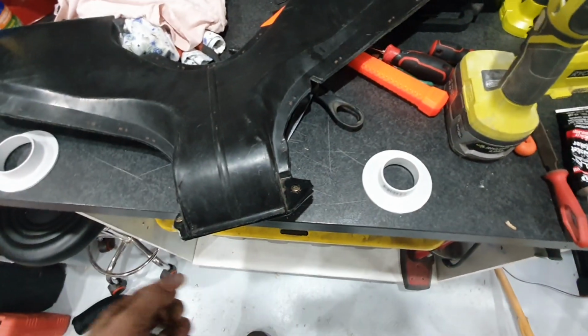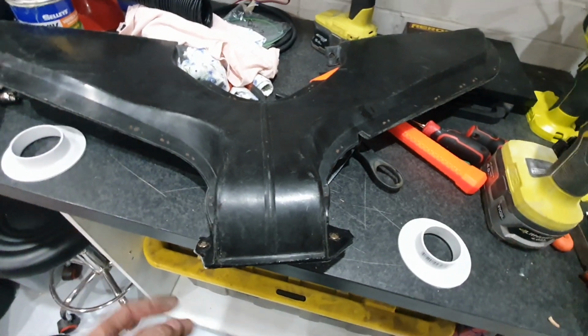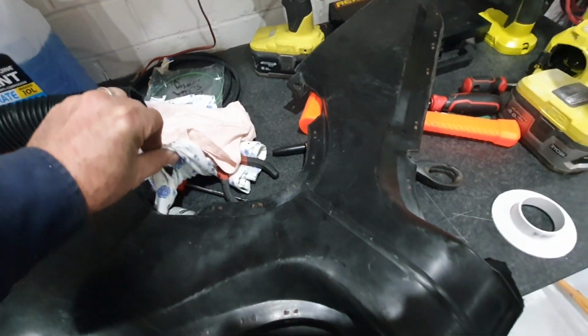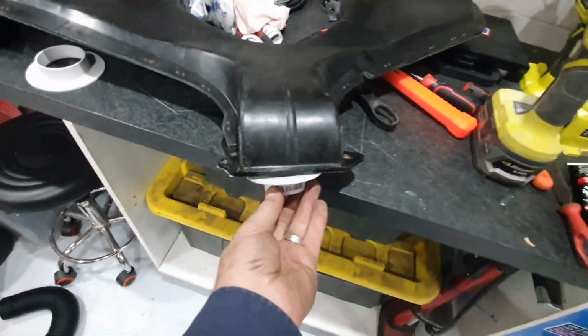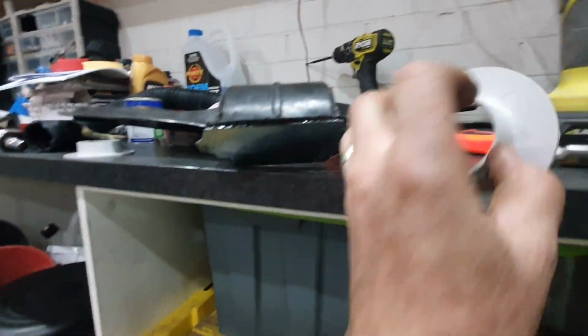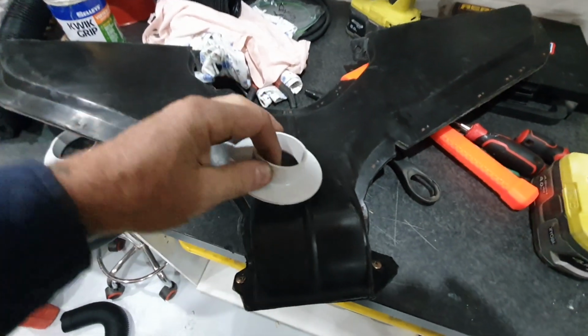I can't cut into it around the back because it fits really close to the firewall. Now, I'll check if it fits. If it does fit, I'll do it, but there's a pretty good chance that it's not going to fit. So what I've got to do, if I can, like I said, is mount those flanges on the back, which would be really neat if it fit in there. But if it doesn't, I'll just grind this bit of ripping flush.